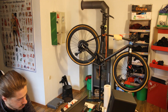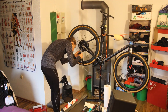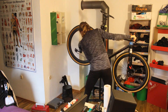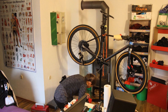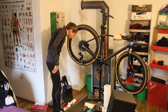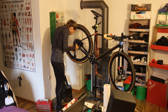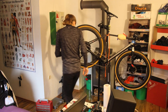Fellow Canyon fans will also recognize the seatpost — a carbon suspension seatpost that diminishes road vibration through a spring-leaf design. Invented by Canyon and Ergon, it comes with very little weight penalty, but does carry a hefty price of €250. Since I wasn't even sure if I needed a straight seatpost or one with setback, I ended up buying a Chinese replica available for under €40 on AliExpress. I've used it already and am happy with how it performs. It is fairly well built, though mine came undersized — luckily the design allows for a plastic spacer to be sandwiched between the carbon leaves to bring it up to the proper diameter.